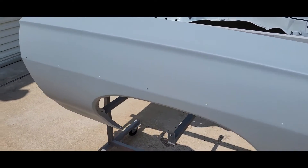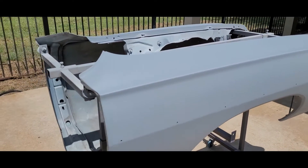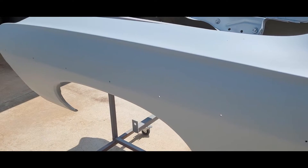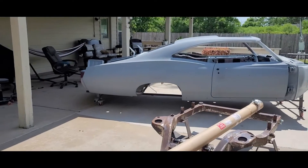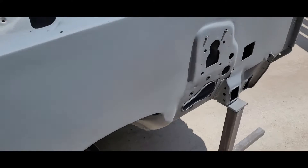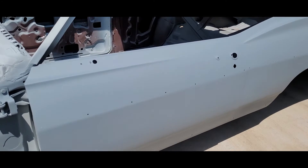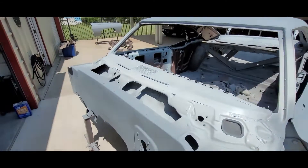All right, I got these things in two coats of the high build — about 12 ounces each round — and we're all out of high build. Sprayed about 100 ounces today. Of course it's not much to show off, just primer, but a big step. Got this car out here baking — it's probably a cool 97 degrees by now. It's already dry, dry as soon as it came out the gun. This weekend's plan is to guide coat in 180, which is personally my favorite stage — looking forward to it.